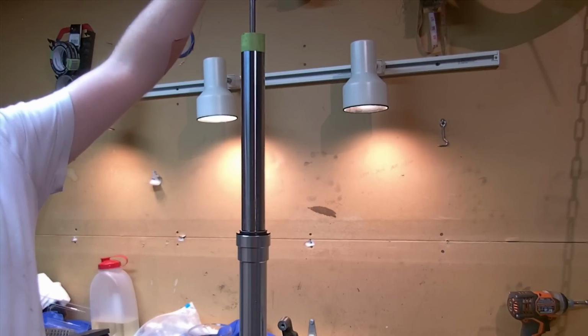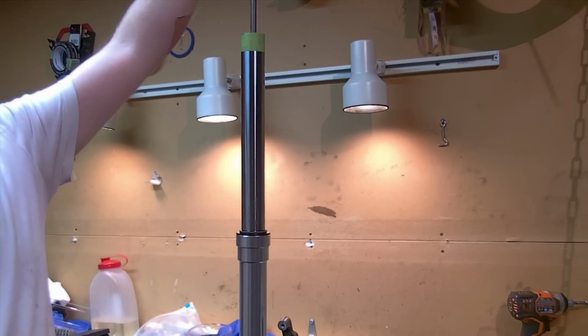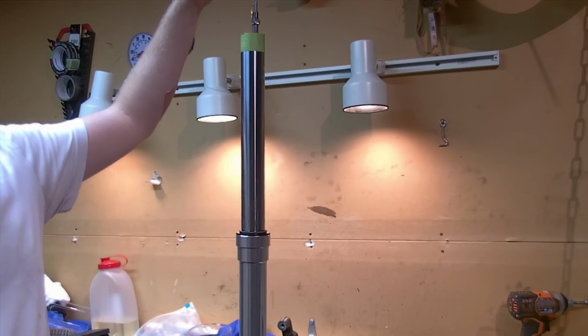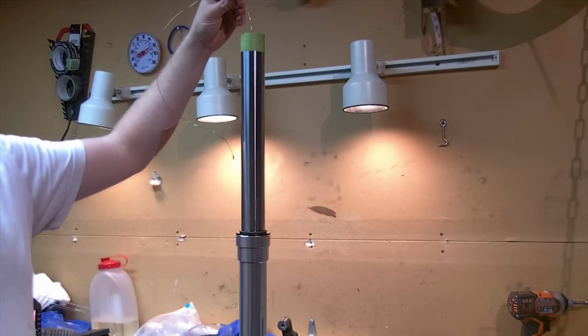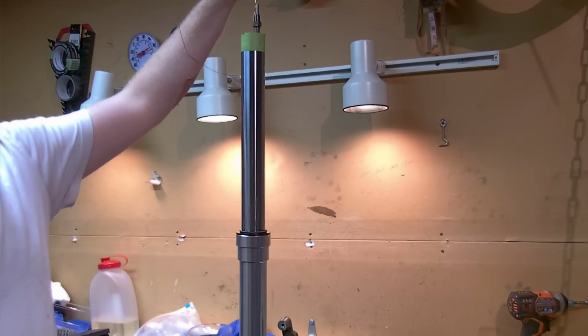And our point of going slow here is to give a chance for the air to escape and not to encourage any new air bubbles in our fluid. Let's say that was 4. Notice how much slower it's reacting now as it actually has oil to go through. You can see the dampening effect of our damper assembly. So this must be 6.